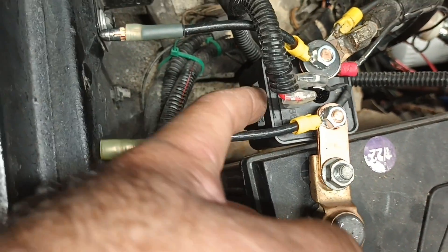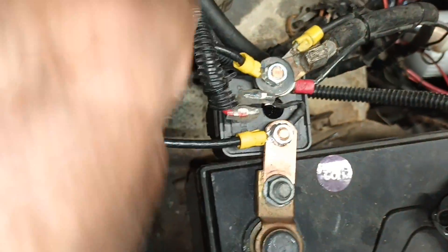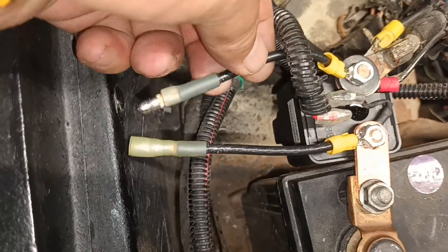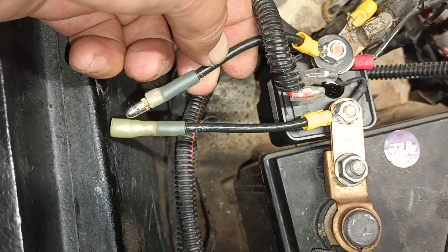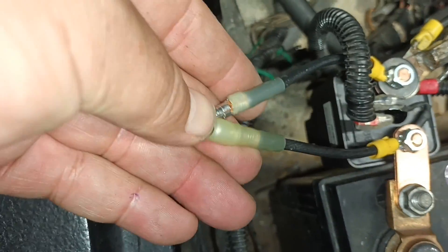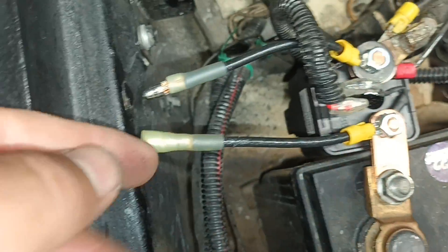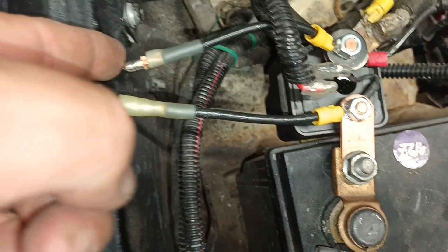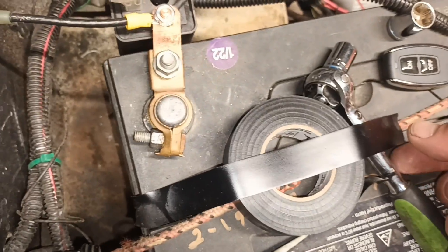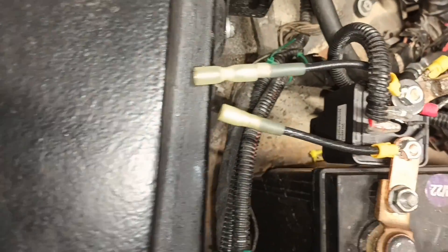I don't know how good the quality is since I just bought and installed it. If you connect these two wires together it will cancel the kill switch and your car will continue working normally. This is a heavy gauge wire — I think it's a 10 or 8 gauge — so it's thick enough to start your car. I put a connector on each end for protection and some electrical tape, and I'll hide them on the bottom where hopefully I'll never need them.